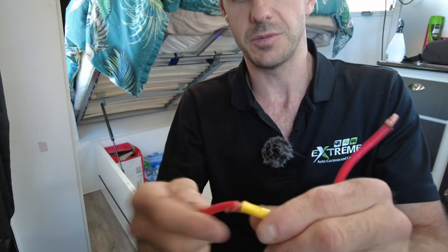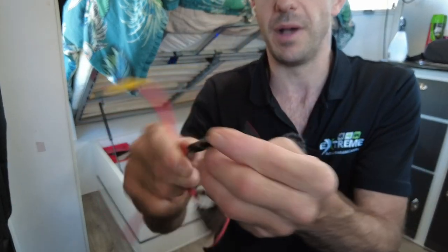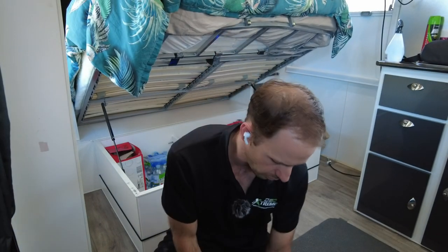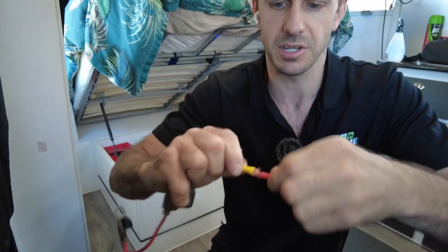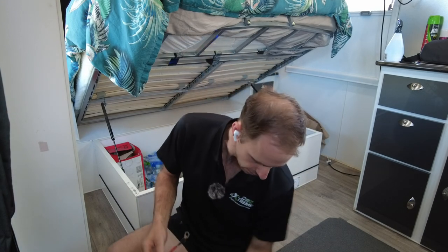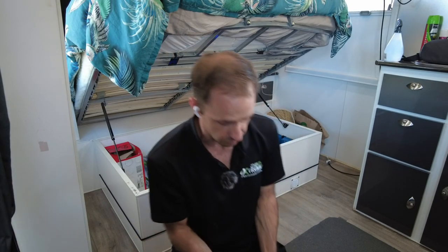If you open your chassis-mount batteries outside and check them, you can see these inline blade fuses — quite common. There's a bit of tape over them. The earth point on this one is horrible — it literally fell out, the crimping had even missed it. When undoing the tape outside, it was just pushed in with tape wrapped around it. And this was the compressor fridge circuit. When we do the relocation from outside to inside, we use MIDI fuses. Your MIDI fuse has the proper contact area — no heat accumulation, and you can get the right size lug on it.